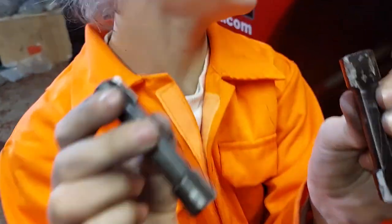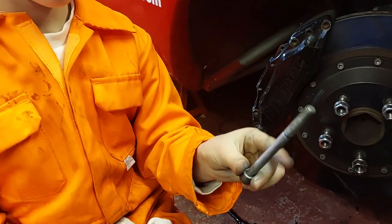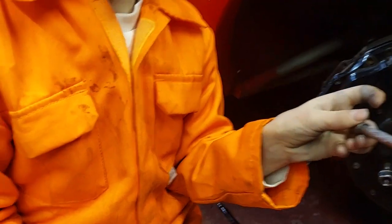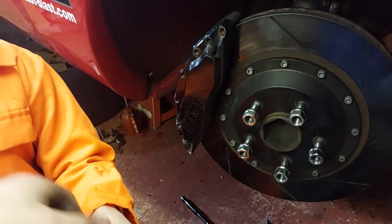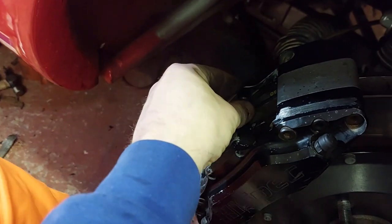When you get older you live on the coffee. So what we need to do now - hold the bolt there. I'll put a little grease on the shoulder of the bolt only - not on the threads - just so that it doesn't seize. Put the square edge of the bolt so it lines up into the two holes.